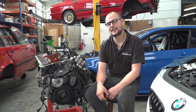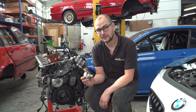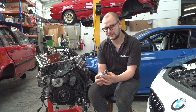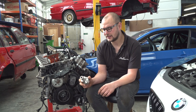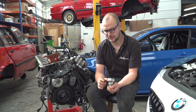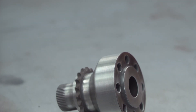However, there is still the outright chance of those sprockets being able to turn on the crank hub. So for that, we switch to a full crank hub, which is the job we're doing on this white car here today. Rather than the timing sprocket being a separate piece to the crank hub, it's all one piece. And to stop the whole hub spinning against the crank, it's splined on the end — so that cuts into the end of the crank and physically cannot move once it's all in there and tightened down. You actually need a special puller to get it off again. It's very much a permanent fix in our eyes, and that's exactly what Carl has gone for.